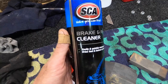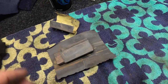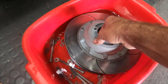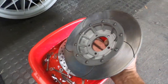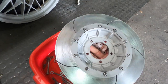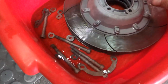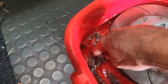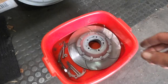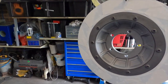I've just finished resurfacing the discs - there's some 600 wet and dry. I used the actual brake cleaner as the lube for the wet and dry paper, had it on a block so it's nice and flat, just little circular motions. You can see here they've come up pretty bloody nice. Just in the acetone bath at the moment - grab this one out, looking pretty fresh. It's all sandblasted, still a few little marks on it, but I don't mind that for the money I'm saving. I blasted all the bolts and the lock-off little tags as well.